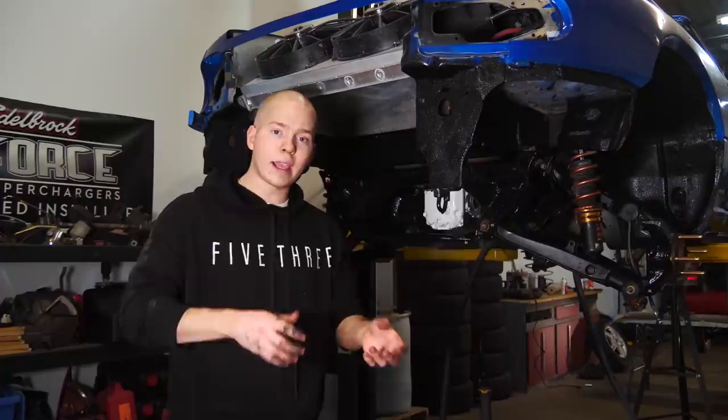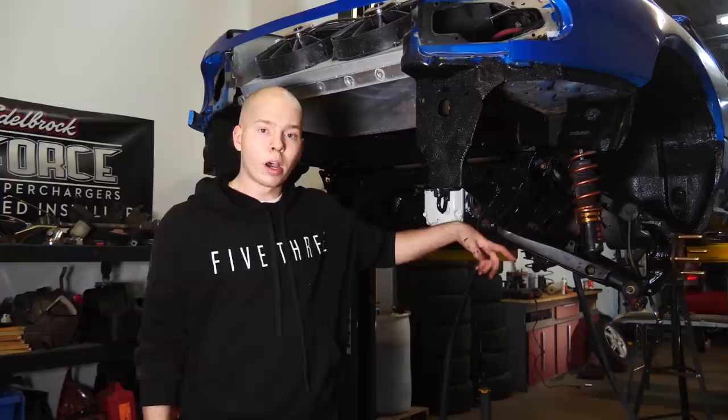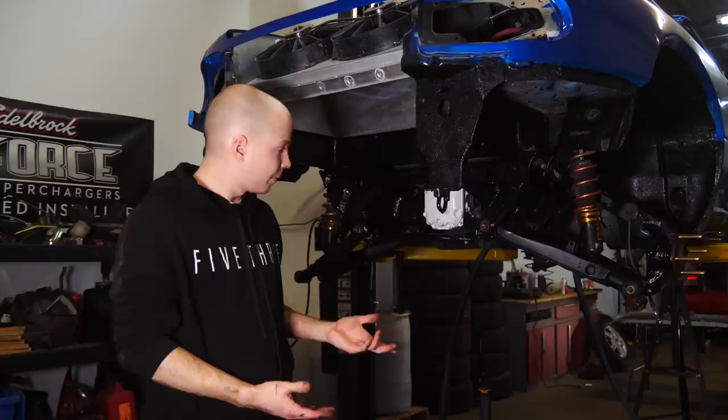It seemed like it was locked in there, but there was still a gap between the seal and the stub of the axle. And when we tried to bolt the hub on like that, we couldn't get it in far enough because it was just too long. Even compressing the axle, it was just too long. Not a big deal, we'll get it figured out with Drive Shaft Shop. They'll fix it or I'll hammer it in harder, whatever. The drive shaft fit perfectly, so that's awesome.